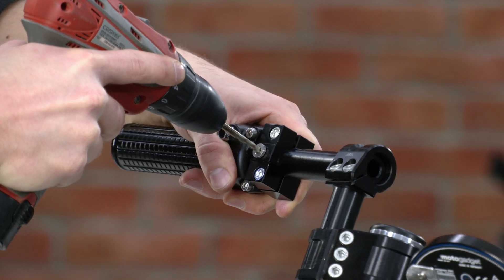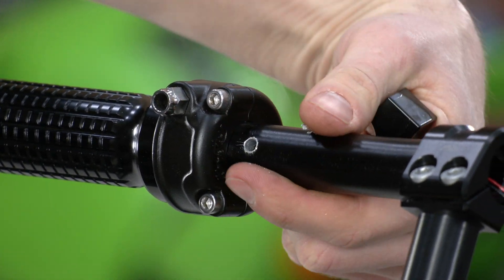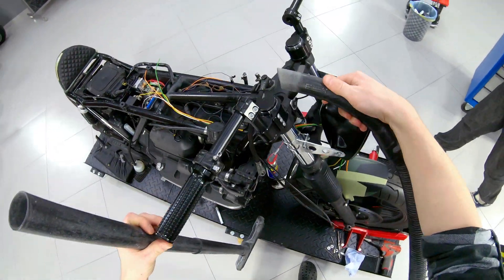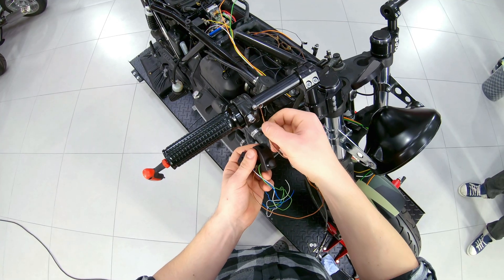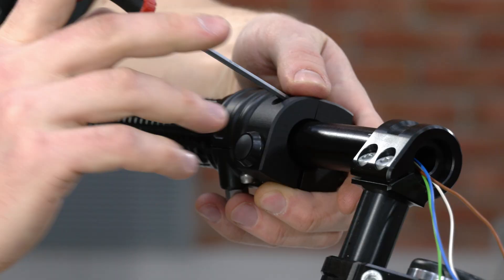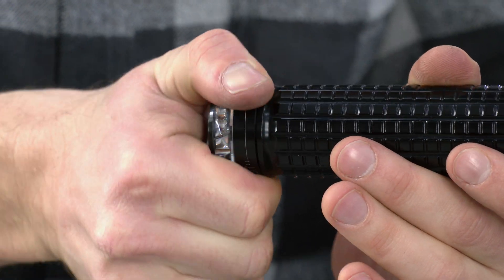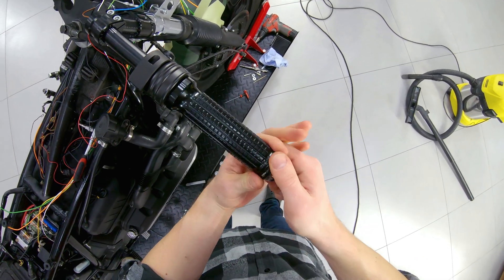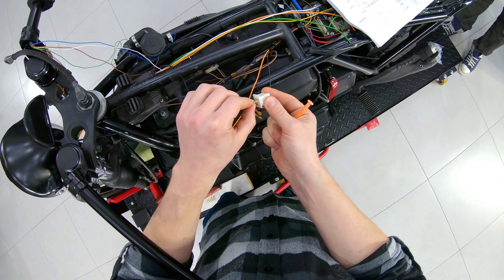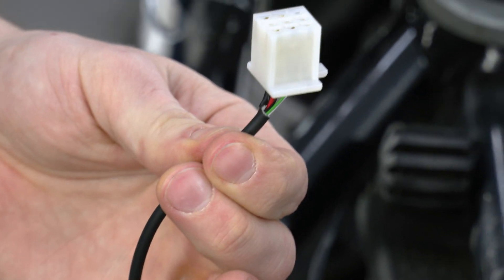Before drilling, remove the turn signal to avoid touching its wires. Barbs and sharp edges must be ground off as they can cut the wire. For convenience of drilling and wiring, I rotated the tube, so it must be returned to its standard position. Now we can finally install the turn signal. The rubber spacer is tightened by hand. The body must be with the logo upwards, so that the turn signal shines both back and forth. The Motoscope Pro gauge is connected via a 9-pin connector. It should include signals from the speed sensor and tachometer, which can be standard from the ignition coils.